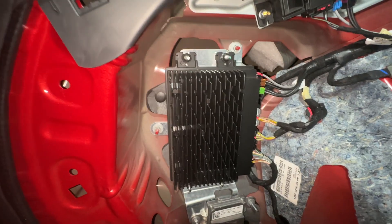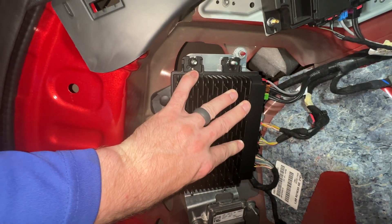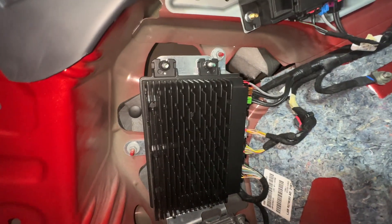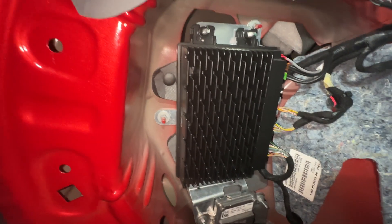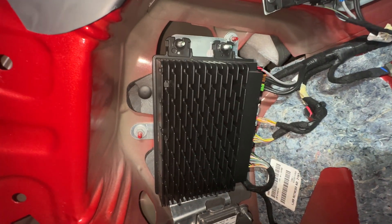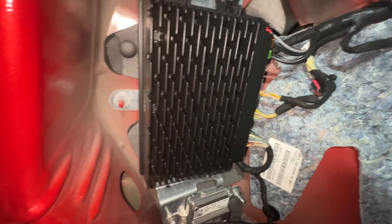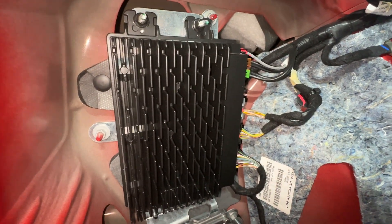The 2025 Mavericks are now Sync 4, and this box is behind the back seat against the back wall of the cab. Keep in mind the 2025 Maverick won't work — it's got this box and you can plug a Ford Q4 connector into it, but it has an encrypted CAN bus and you won't be able to actually do anything. Same thing for the 2024 and 2025 F-150 and the 2025 Lightning, and most likely the 2025 Mach-E, although we haven't confirmed that yet.